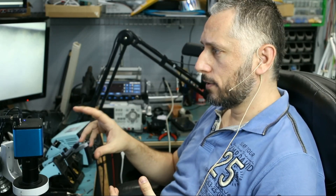In this video, we're going to be working on an iPhone 6S Plus that came in for no power. The customer is a repair shop — they sent three phones, and one of them is this particular phone. The customer said the phone is constantly charging at 0.4 amps. Even if you power the phone on, the amperage being drawn is the same. The phone does not power on, the battery is not being charged, and when you plug the phone into iTunes, iTunes cannot see the phone and it is not being recognized by the computer.